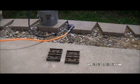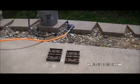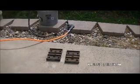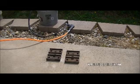So, if you're going to do sandblasting and whatnot, you want to wear the proper PPE. And PPE is personal protective equipment. For this, what you need is a blasting helmet, something of this nature. I guess you could do a welding helmet if you want. But this keeps it out of your face, keeps it out of your eyes. You do not want to get splashed back in the eyes by sandblasting material. It really hurts. It doesn't want to come out of your eye bibbles. And, yes, eye bibbles does stand for eyeballs.